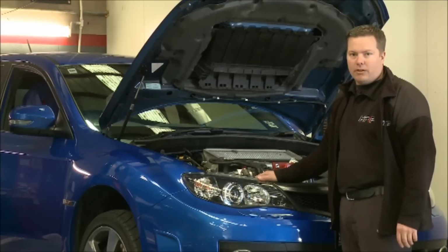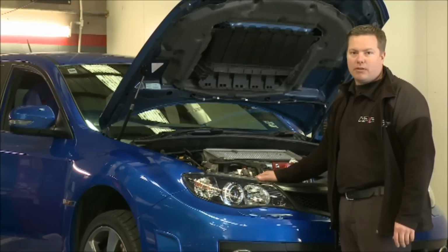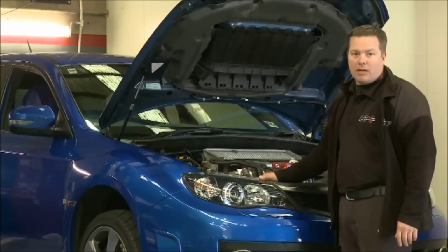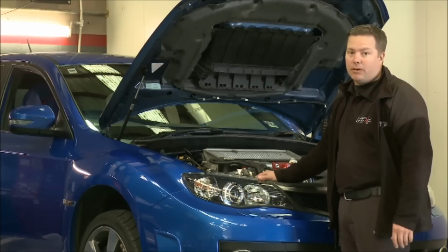We want to be a little bit careful not to hurt the engine, so we're going to upgrade the pistons, put some forged pistons in it, and then we're putting a larger Garrett roller bearing turbocharger on it, which fits in the factory location. That'll give us enough room to put another 4, maybe 5 pounds of boost, and maybe get another 40 or 50 kilowatts at the wheel, so it'll be a good thing.